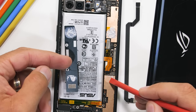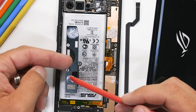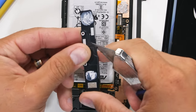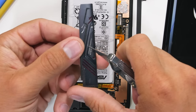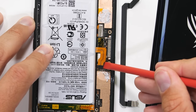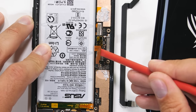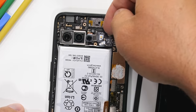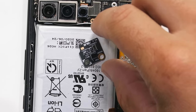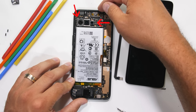Take a look at that — thermal paste galore. ROG really is using that slab of metal as a heatsink this time around, which is a substantial improvement over last year's decoration. Major thumbs up for that design upgrade. There's the battery connector — I'll just disconnect that like a little Lego. The flash also has its own little board, just like that smaller RGB board we lifted off earlier. Then I can remove the two motherboard screws along with two more screws holding down the camera units.